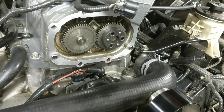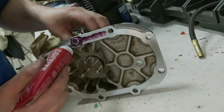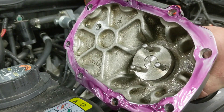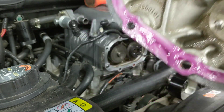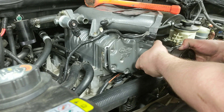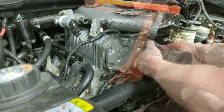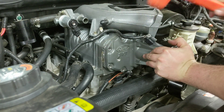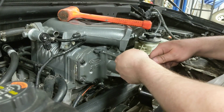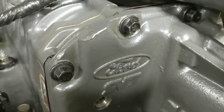I might try and be a little bit sparing because I don't want it to be everywhere. The blower snout is all coated with Loctite 515. I tried to use not a ton of this stuff because I just didn't want to make a goopy mess. Got that slapped back on there and we didn't make that big of a mess - I think that was about the perfect amount. It gushed out just a little bit all the way around.